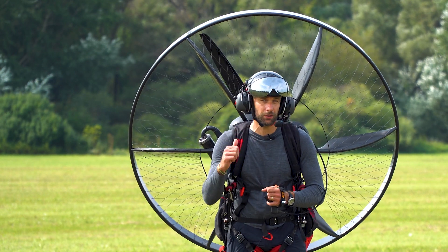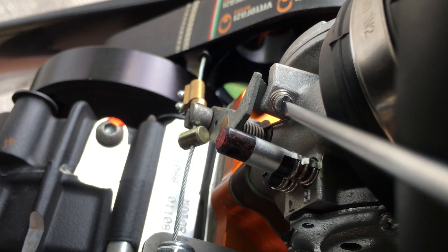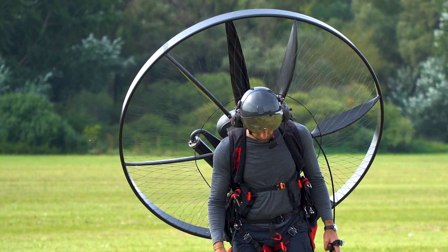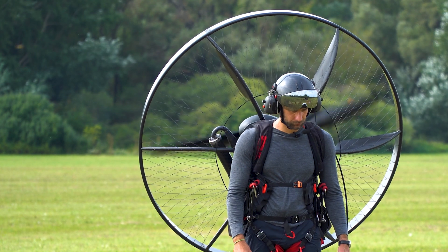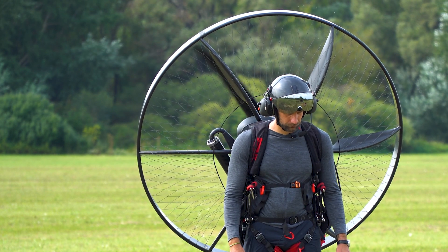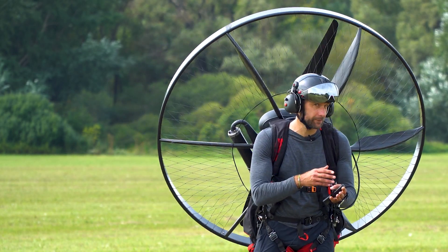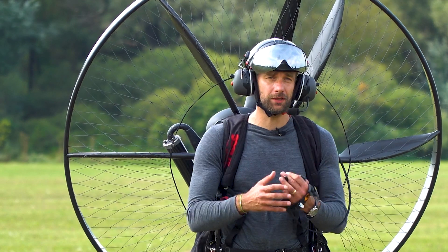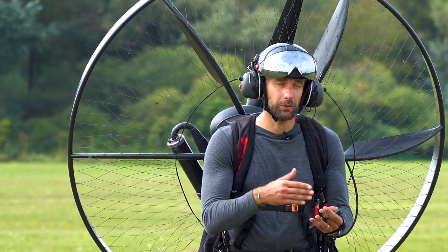I want to show you how it sounds when it's too low — please open the idle screw. You've seen that the motor is reactive, the low needle is fine, but it idles a bit too low — it was rough, shaky, with vibrations, and wasn't smooth. This is how the engine sounds when the low needle is tuned right but the idle screw is set too little.